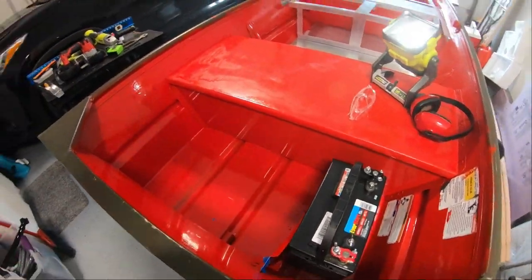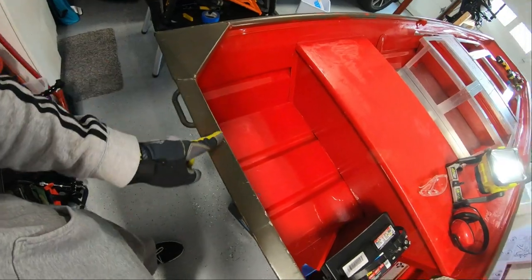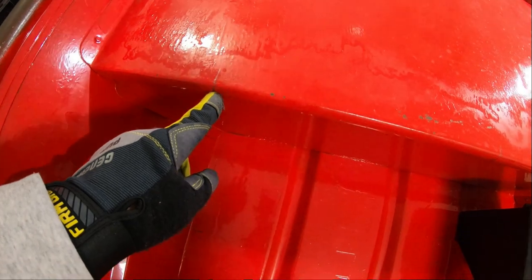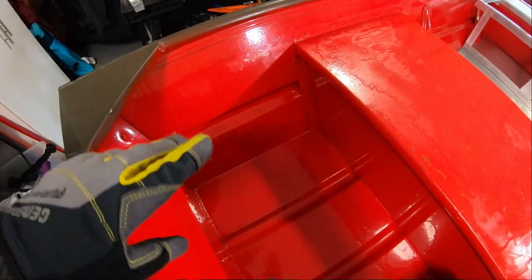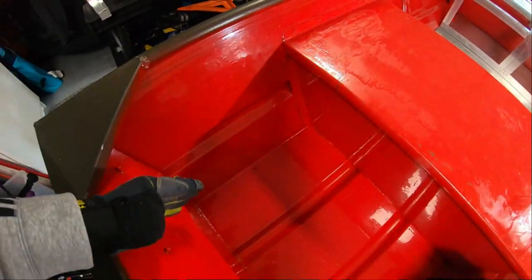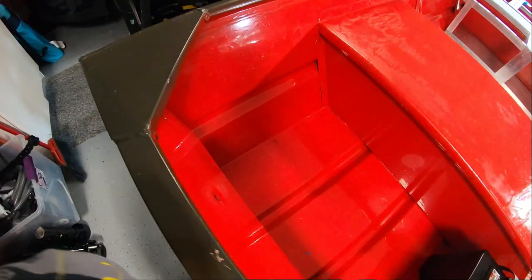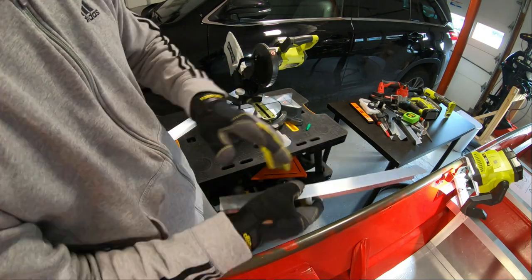The hatch will almost be the entire length of the middle of the transom area. The opening for the lid will be 28.5 inches wide. I found center of the bench and marked my edges for the lid on both sides of the mark. Before I frame out the hatch, I'm going to lay tracks for the deck support first, because if I lay my track here it's going to limit my access to install the tracks along the side of the boat.